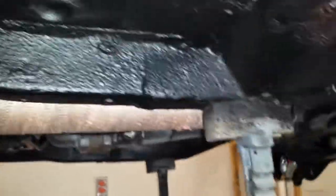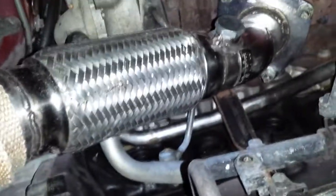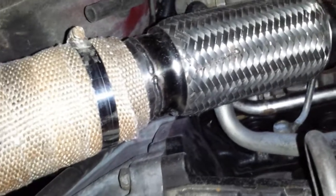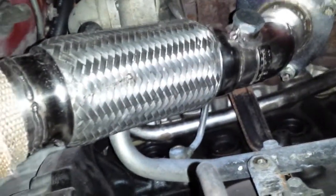For the downpipe, this is a Megan Racing stock 1JZ application downpipe. We didn't buy it. It came with the car. Normally we would get something from one of the vendors. But it seemed like it would work all right, so we threw it on there. It seemed okay at first, but I ended up having to cut it and re-weld it in like 3 different places, and spent quite a bit of time clocking it correctly. But the fitment did turn out quite nice.